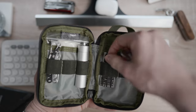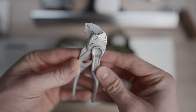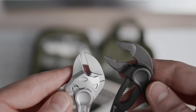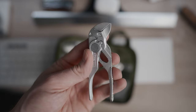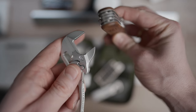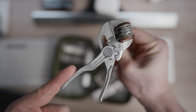For tools, space is very limited so keeping things small and lightweight was a major concern, but I think the setup still lets me get a lot done. First is a small Knipex pliers wrench. These are the Pliers Wrench XS — essentially the toothless brother to the Cobra XS, meaning it's not quite as versatile but won't chew into or round off your bolts, which is especially useful when working on exposed bolts on a bicycle or motorcycle. You can adjust them one-handed and the mechanism won't let go once gripping, which helps transfer more force when loosening or tightening.